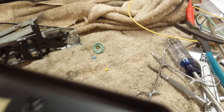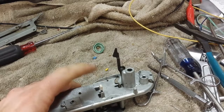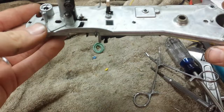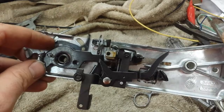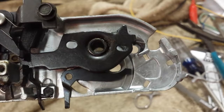Let's set this down and move the deck with the tone arm aside. So here it is — there's your 10-inch feeler, there's your 12-inch wand. These come off of here. You need to pull this e-clip and clean and lube that. You can get to the rest of the parts much easier this way. A failure mode you commonly see on these is that the machine won't quite shut off — the knob will turn but you won't hear the click of the power switch. That's because this bushing here, which operates the lever, the fork that turns the power switch, gets sticky. This one is just starting to degrade. In order to fully clean this, you have to remove this piece — there's a little snap ring on there, and you need to get that off in order to deal with the part underneath.